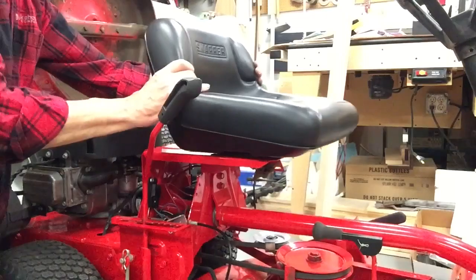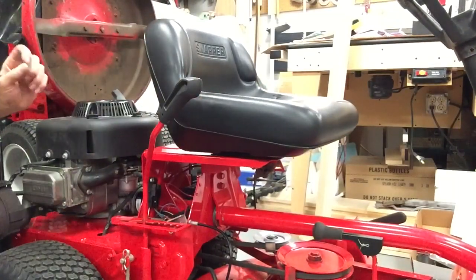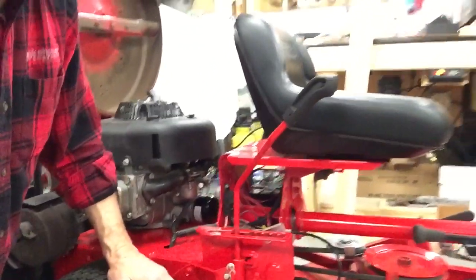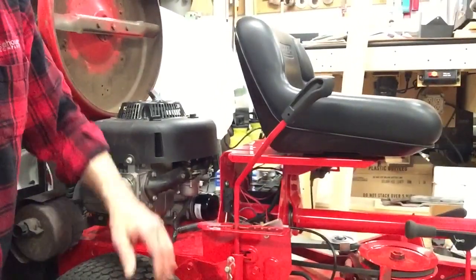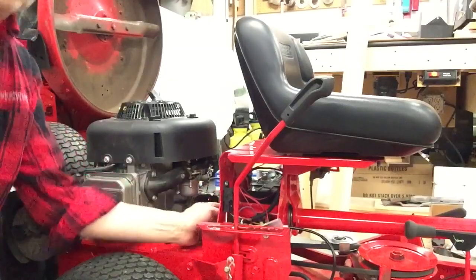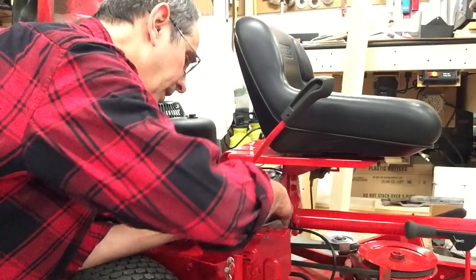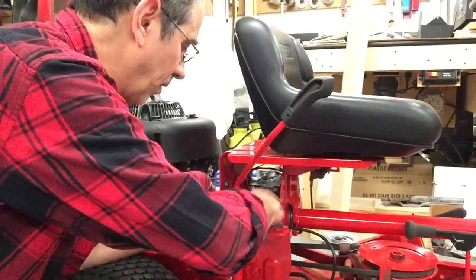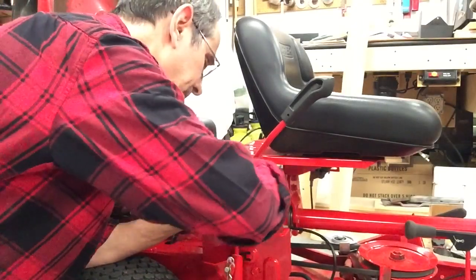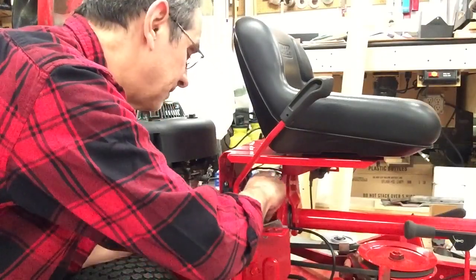And these are adjustable seats. Now I got one other wire I got to hook up that I didn't hook up until last, so I didn't have any issues. It's the red wire that goes up through your tube to your ignition switch, and that is what sends power up to your ignition switch. And back in here somewhere is the other end of that wire.